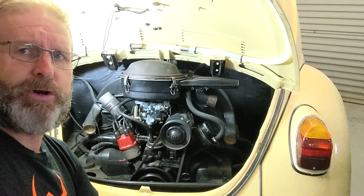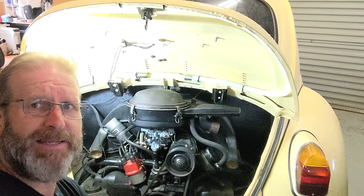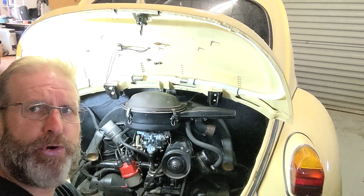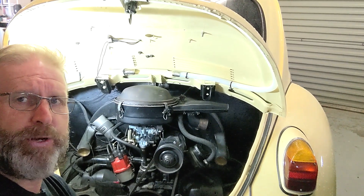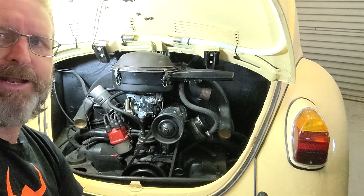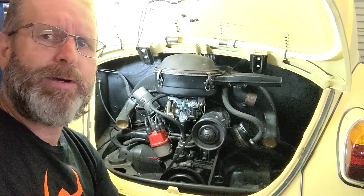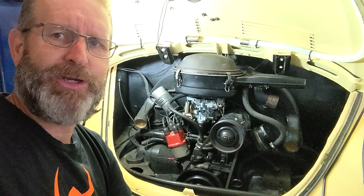Some of you may have noticed if you look up in the boot lid — I've got a fire suppression unit running around the inside in there. It's a pressurised standalone unit I bought online for about $250. It just gives me security when I'm driving — if there is a fire, it melts the tube at the point of the fire and high-pressure chemical is sprayed into the engine bay, putting it out instantly. Anyway guys, hope the video is helpful on the little Pict 31 carby, running the standard air cleaner and the tune. If you find it useful, hit that like and subscribe and I'll catch you in the next video.